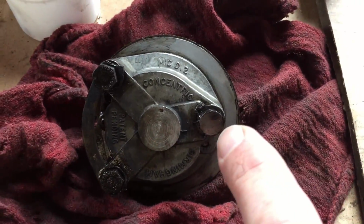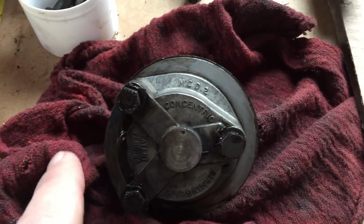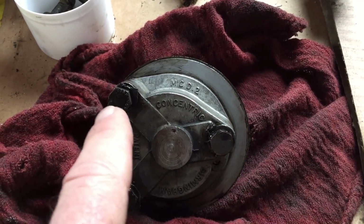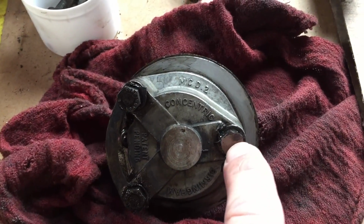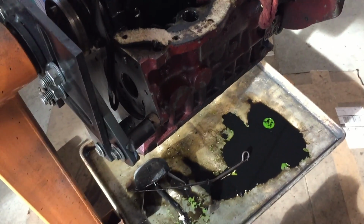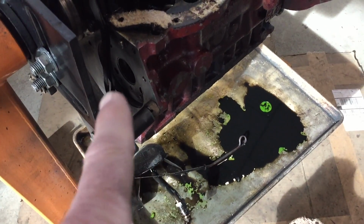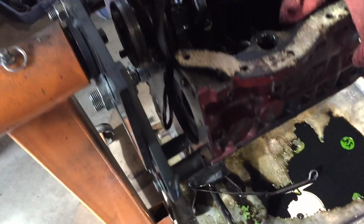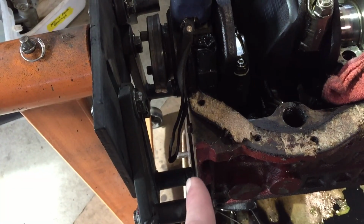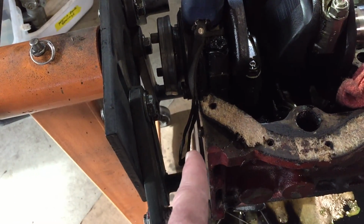And here's why. This bolt here, the hole's on the other side, so would the bolt be if I turn the pump over. But anyway, it's chafed here because of the flywheel. Those are not chafed. That one's been grinding on the flywheel. And why? Well, this is a 1275 block from that car with a 948 camshaft in it. That's where the oil pump lives. There's the back of the crank. If you're unfamiliar, the flywheel rides on there, and this was sticking out too far and hitting the flywheel.